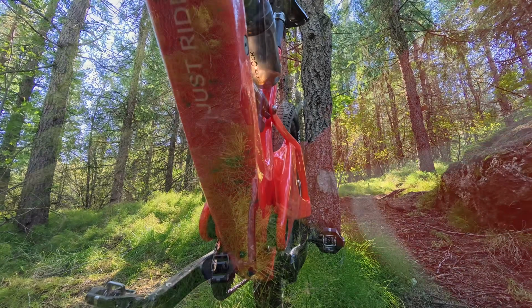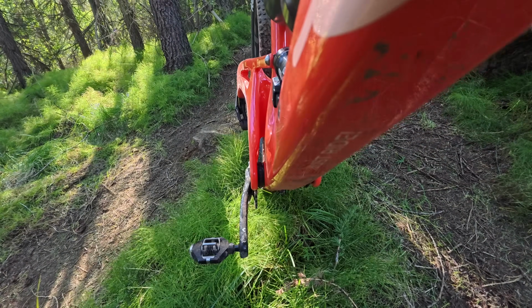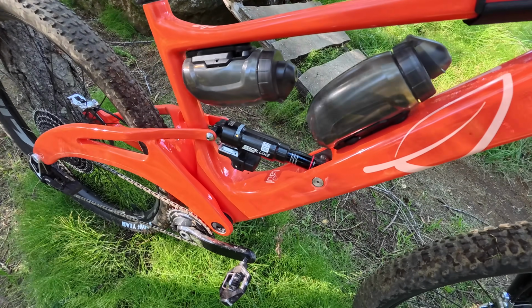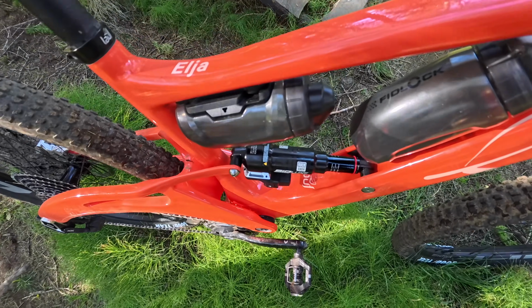For starters, it's pivoting on a 29mm DUB-sized spindle, which let them use a DUB bottom bracket as their pivot bearings. Simple, reliable, and easy to source and service. That also gave it a massively wide stance, so there's very little lateral or torsional flex in the frame.